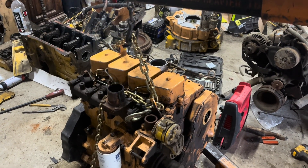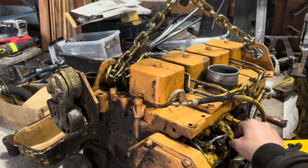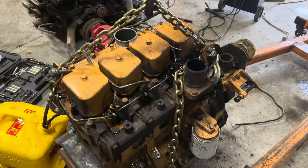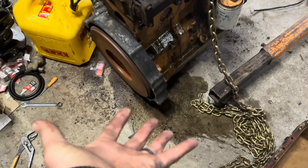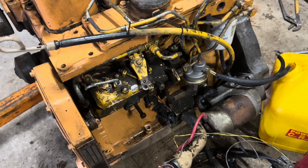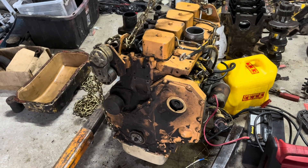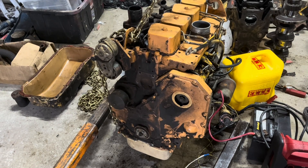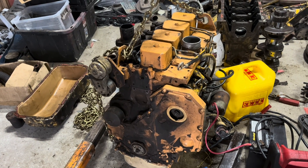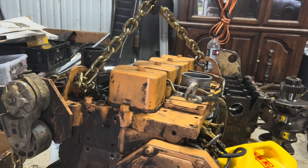It's going down! Turn it off! Alright — wow, that's cool! It sure sounded like it had a weak hole to me, but it also sounded really good. Very loud — oh my God, extremely loud. My ears hurt. Do I dare fire it up and loosen the injection lines one by one and try to find the weak hole? Kind of sounds like a lot of work. Let's see if it still sounds like it's got low compression on one cylinder.